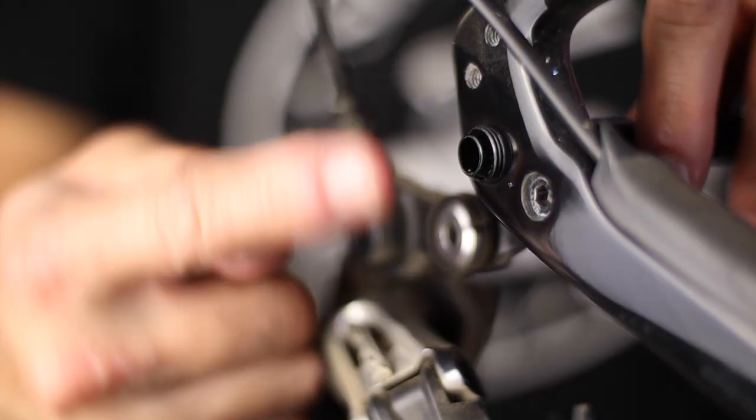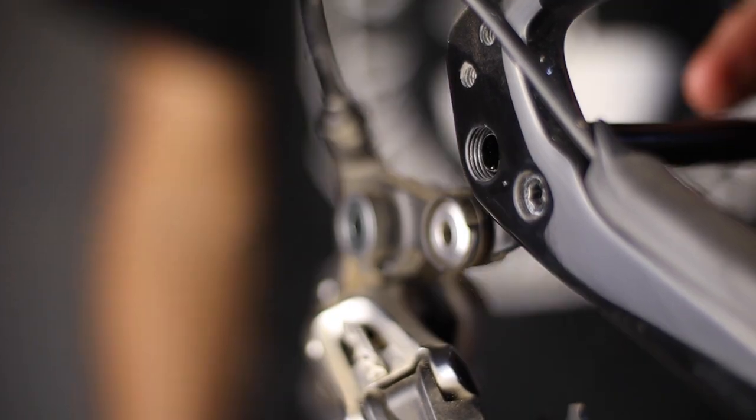According to Eric, who works at the Robert Axle Project, the biggest challenge is to get people to understand that dropout designs vary in width. So there's no such thing as a boost axle, or 142 by 12 axle. With some thin dropouts, an axle can be just 11 millimeters longer than the hub, where on some full suspension designs it can be up to 52 millimeters longer. So what this means is that even if you get the general specs right — for instance, a 148 by 12 boost rear mountain bike axle — the overall length can vary from bike to bike. And if you're not careful, you could end up with an axle that extends way past the dropout, or only partially threads into the dropout, neither of which you want.